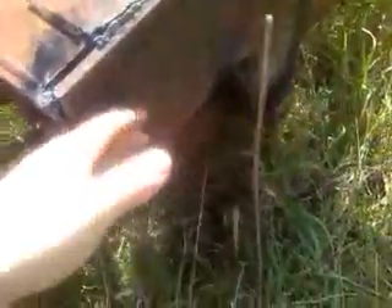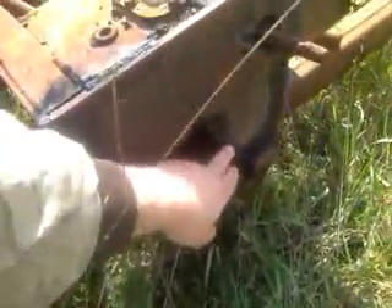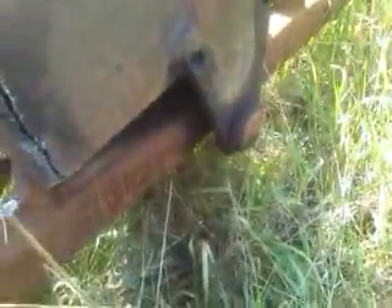As you can see, they put a plate here along the frame rail and welded it right to the frame rail. They did drill holes and bolt it through for the bolster. Then they had a piece of steel across the front and made up a new front bracket — different than the original anyway. They welded that right to there, and then welded the ports there. The guy said his father did the work.